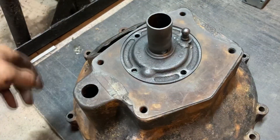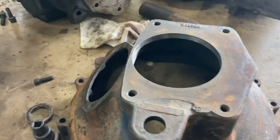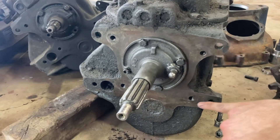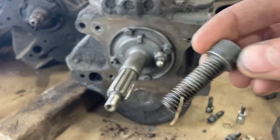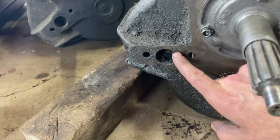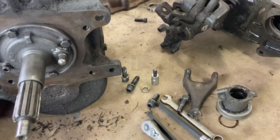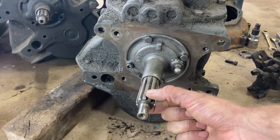That's exactly how you want it. Next step: drill and mount. It fits quite well — I can't really take a picture and hold it on there, but I'll show you tomorrow. These three holes line up with the stock holes, so all I have to do is bore them out a bit. The threads are gone, so these slide in. This one is inboard a little bit — you can see where the stock T90 hole is — so we just drill that one, the threads are in there, then it bolts up and uses the stock shift fork and throwout bearing.